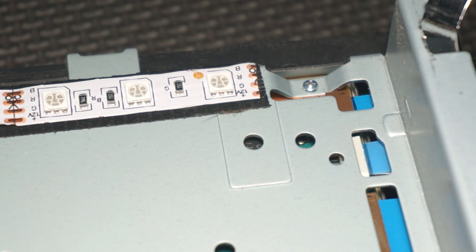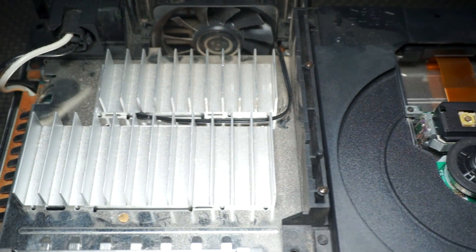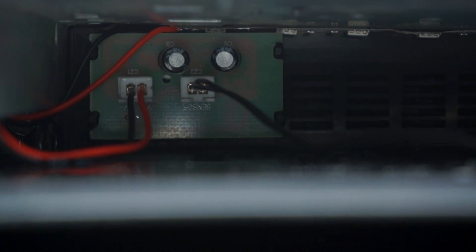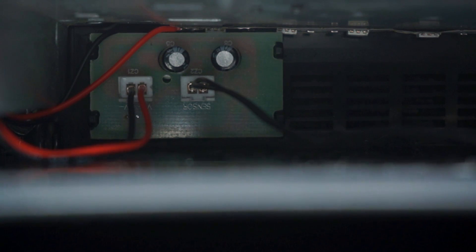Since I had this LED strip running practically to where my LCD is, I just pulled power straight from it — positive to my 12 volts, and in the case of RGB strips the particular color I chose is my ground, so the blue B-pad. I snaked my temperature probe through the back and just placed it between the heat sinks. Not sure if this is the best place for it but it will have to do for now. One thing to note is this LCD is a very tight fit, so take that into consideration while you're cutting your hole — something I didn't do, but I fortunately lucked out and it fits together just barely.